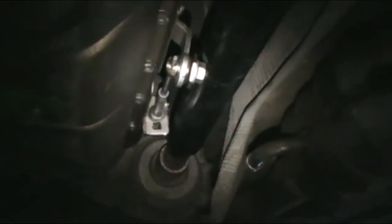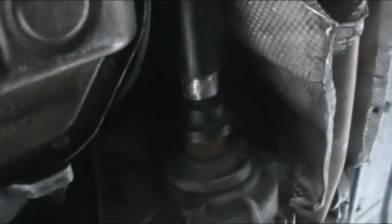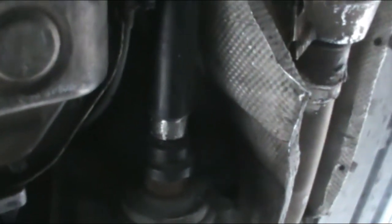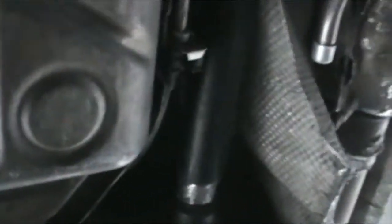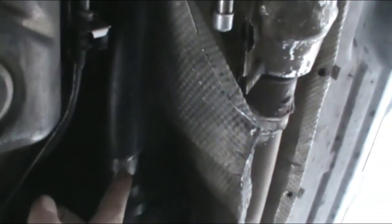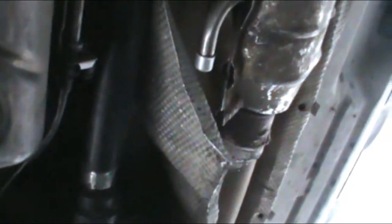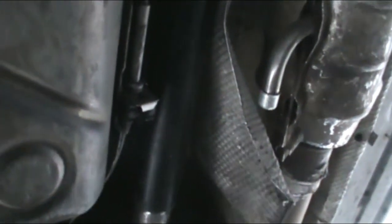I'm gonna call it quits for today, be back at it tomorrow. Here's an update — it's in all the way. More threads than normal, all the threads are in. I did exactly what I said, which I wish I would have done in the first place. I had to grind off the weld that I did so it would slide. Put the shaft in — this can slide in far enough obviously, you can see all that grinding. I slid it all the way in, so I was able to get it in the splines, get all that mounted. And then this was pressed in all the way, so it's got threads pretty far. Should last a lifetime at this point. Now I just have to re-weld it, because right now it's not welded — this tube will spin on this.